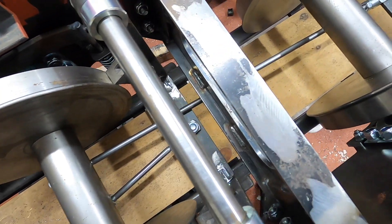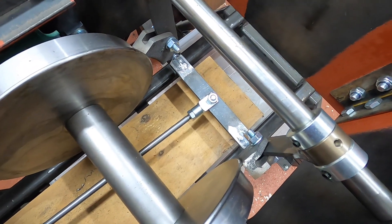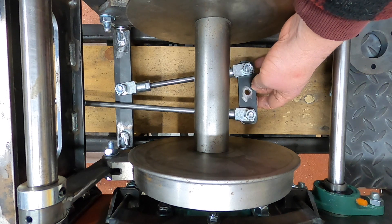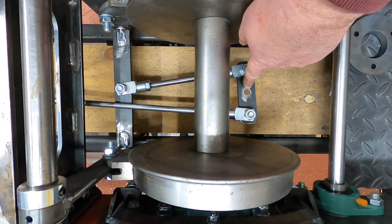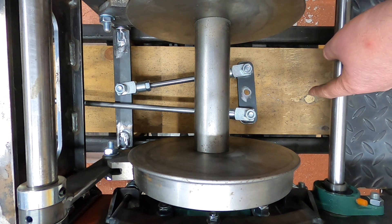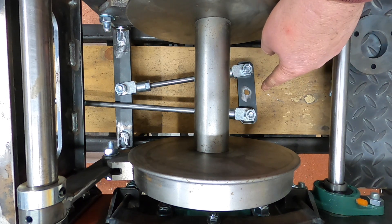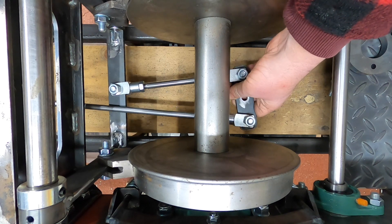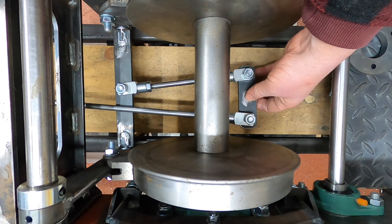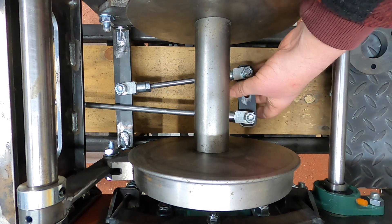So you've just seen me install these rods, which are the brake linkages which link everything up. This here is the equalising bar which we next have to connect from here to this layer shaft over here — a boss with an arm coming down, with then a linkage that goes between the two. So as this rotates it pulls this and puts the brakes on. And obviously because it's pulling in the middle, it doesn't matter if one of them is slightly out — it'll equalise itself out.